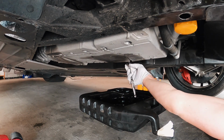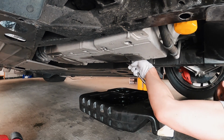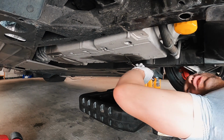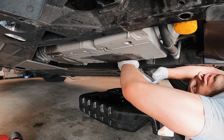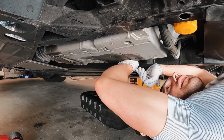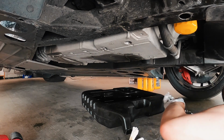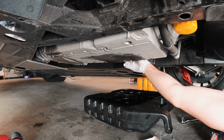When you guys retighten this bolt, it's important not to do it too tight because it will tighten over the course of your time between oil changes, because obviously it gets hotter, and you don't ever want this to get jammed, because if you do, then you got to drill out, you got to remove your entire oil pan. That's a disaster. So we don't want to ever over tighten it. I can't promise you that I didn't already do that. So let's see. Oh, it's perfect. Not bad. You don't want to under tighten it obviously, but you certainly don't want to over tighten it.